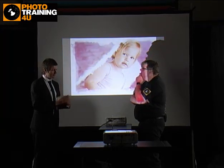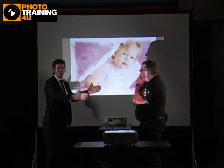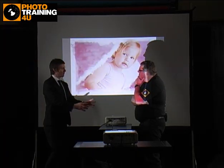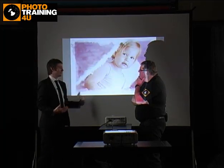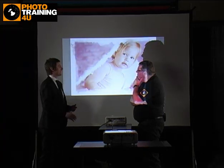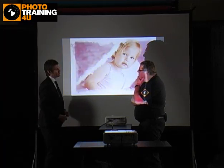Yeah, there are different ways, but if you can work out the width of your screen and you know roughly where you want to put the projector, you then look at the ratio. Or if you've got the ratio of the projector, you can work out what screen size you're going to get from what distance. But we tend to work it as I say, that's 0.6, so we know for every 60 centimetres you are back, you're going to get a 1 metre wide image.